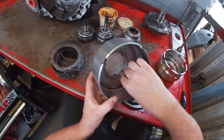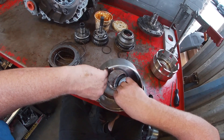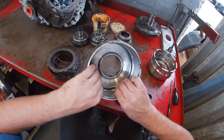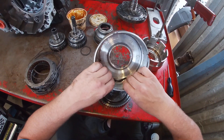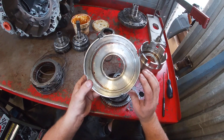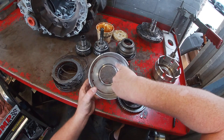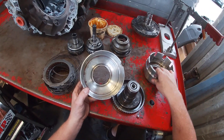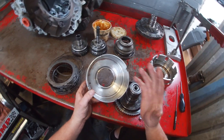This one needs to go in its top groove. You want to start to feed the seal in all the way around while also holding where you've been, so the seal doesn't want to pop out. You can chase these around the drum real easily and not be able to get them in. When you get to this point, it's a good idea to have it up and pop it in with your index fingers. Then apply a little bit of trans gel to go around and lubricate the seal — this will allow the baskets that have seals to drop in nicely and not potentially roll the seal out of its bore or cause it to get cut.